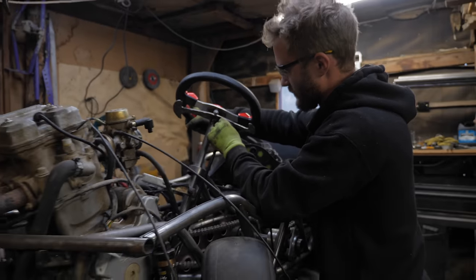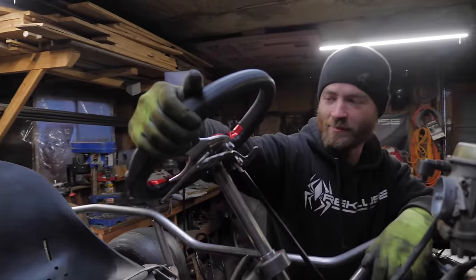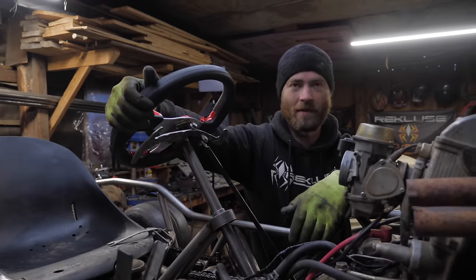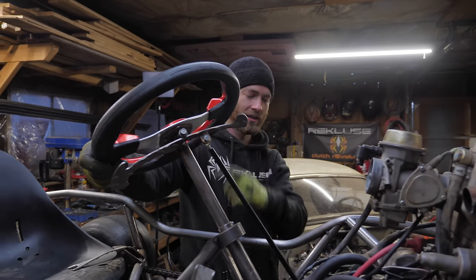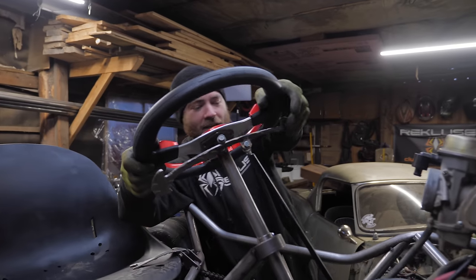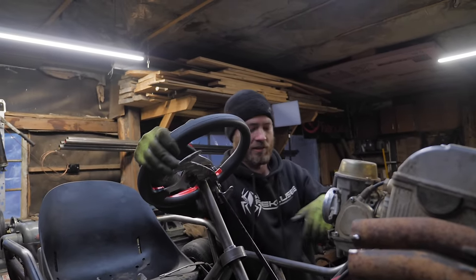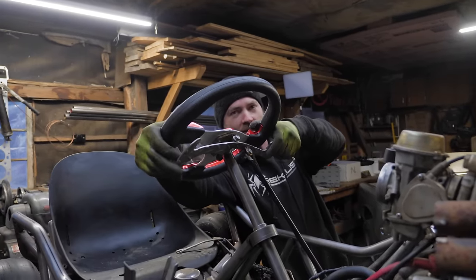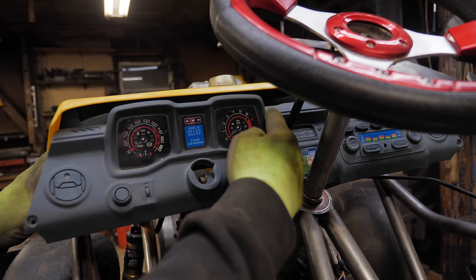It's beautiful now if the rod joints had a little more swivel. I'll keep experimenting because there's a chance it works. I may be incredibly stupid but also incredibly lucky — because if I'd thought about it enough to realize turning was a problem, I wouldn't have done it. But because this car has such a small steering angle, it works. That's full lock to the right and you can still sort of shift. It binds a little but you're not going to shift at full lock very often. It'll be the easiest, most solid way to shift we've ever done. Finding neutral is always a pain — this will be way easier because you can feel it with your fingertips. There'll have to be a slice through the dash up through the tach, which sucks, but it'll be worth it.